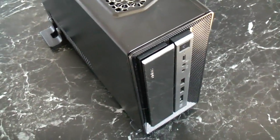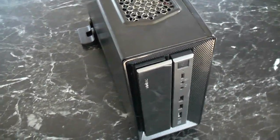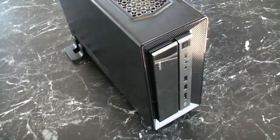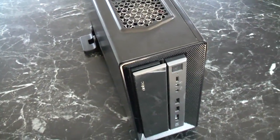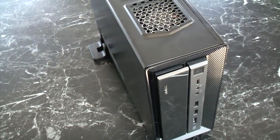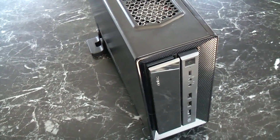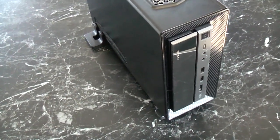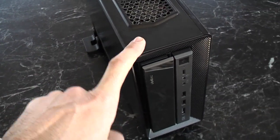The reason I went for the 150 watt version is that the machine needed a bit more power. Mini ITX cases are generally designed for Intel Atom processors, but they're not really that good for emulation. If you run a later version of MAME, its requirements are actually a lot higher — something like Mortal Kombat 2, even a dual core Atom will struggle to run smoothly. So I'd recommend going for a dual core Pentium or AMD processor or higher.